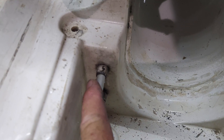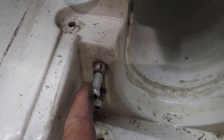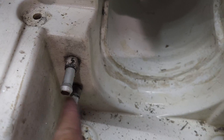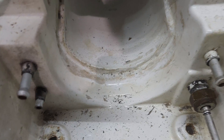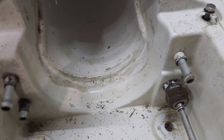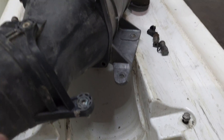These tubes here are aluminum. One year prior — '87, '88, and '89 — these were plastic and they break, so you need to drill them out and replace them with aluminum tubing. This one we don't need to, thank goodness, because there's enough. Everything else this poor ski needs, but we'll continue with the pump.